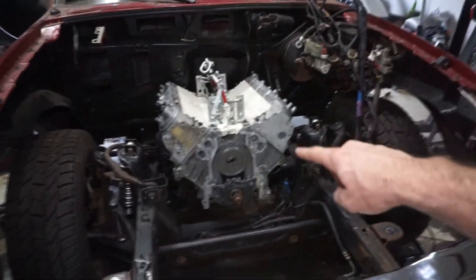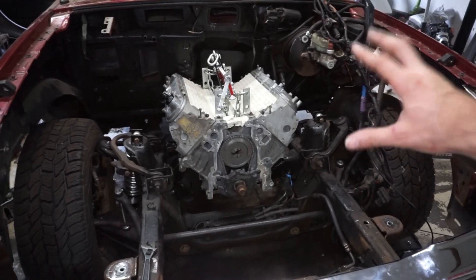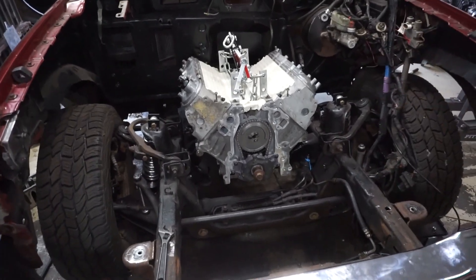For the dual feed on the transmission I put the plug in the case and then put a stock valve body back on it, and that truck is still running like that right now. So it wasn't an internal issue with the transmission. I swapped the valve body over to the Ranger and the issues followed over to the 4L80 on the Ranger - that's actually the main reason this truck has been down and getting rebuilt, because when I started making progress on it the torque converter failed. Then I just kept the truck down and ripped the whole thing apart.